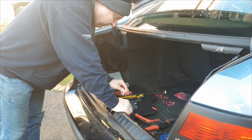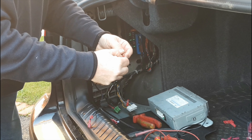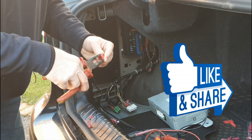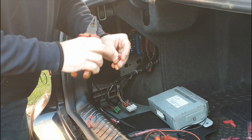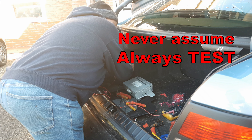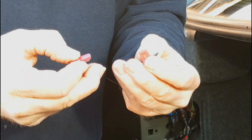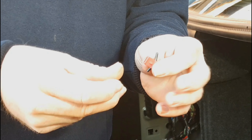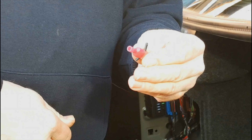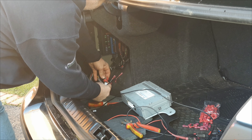This is my boot amp — I've unscrewed it from the floor so I can get at the connectors on the back. If you're connecting to your head unit, imagine this is your head unit with the connectors on the back. At this point you'll need access to your workshop manual or the instructions for your stereo system, or if you're lucky your stereo system might have a pinout diagram stuck to the top of it. Before we can connect to the wires we need to prepare our input cable. Take one end of your phono lead and bare some wire with your wire strippers.